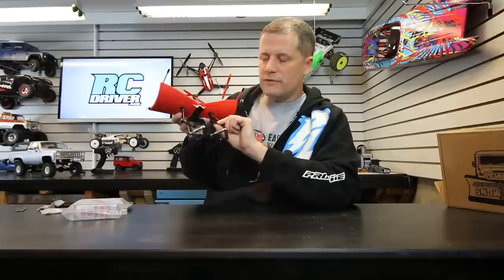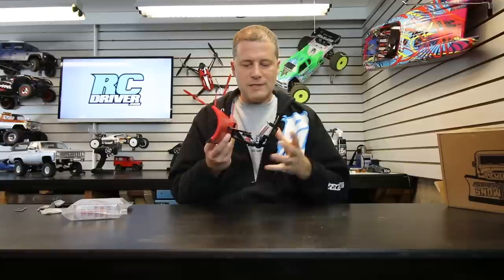And these are 25 tooth servo arms here. So just be aware of that. I found that out the hard way. I actually have two low profile Spektrum servos I thought would work really well right here, but because of the spline count, it's not going to work. So I went out and grabbed some 25 spline servos, and that's what I'm going to use to control it.